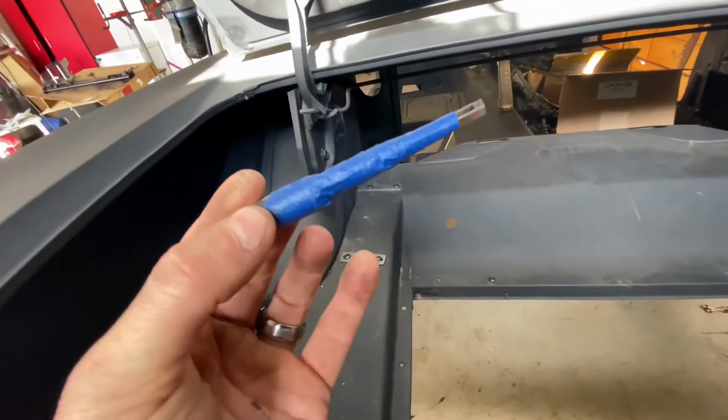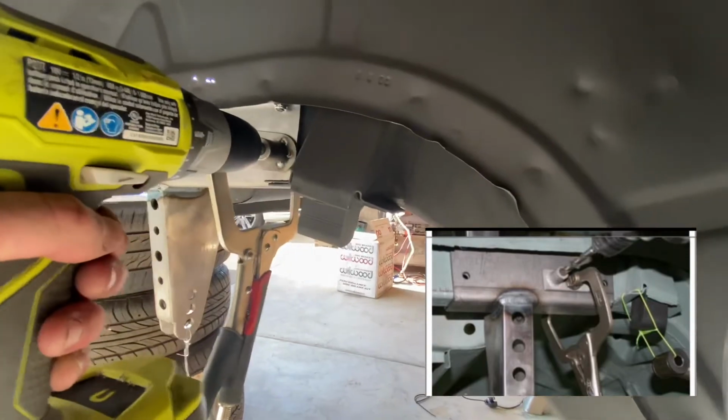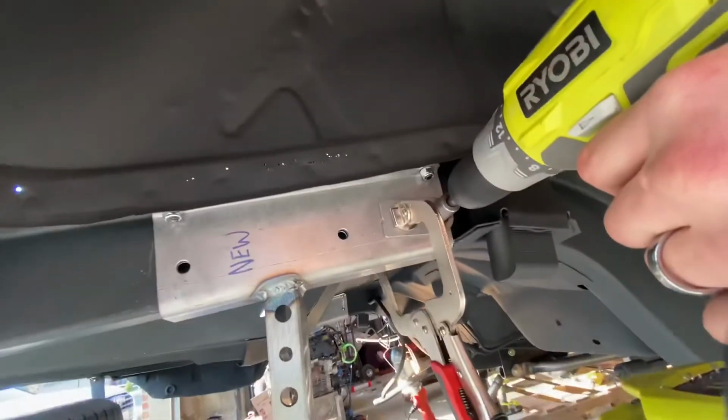Pick 24 and 25. Drill a 3/8 bit into the 3 holes. Once you've drilled the 3 holes, go ahead and put a bolt in the rear so you can hold the channel up. Be sure to use the guide plate to ensure the hole goes to the first and second hole straight through.